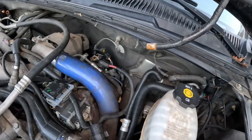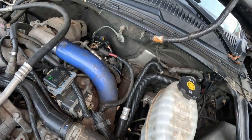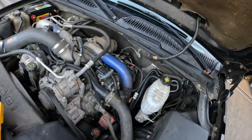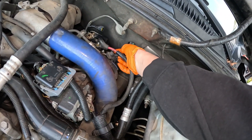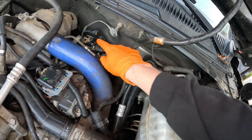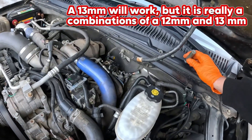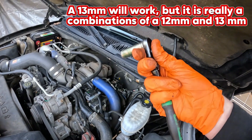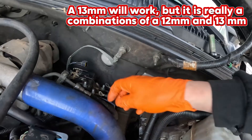I'm going to go ahead and remove this whole controller. Being that we have a live hot wire feeding it, I went ahead and disconnected the grounds on both batteries. Now I can start taking apart these three leads. There are two bolts holding it and we're going to get this out so we can troubleshoot. I used a 13 millimeter and a quarter inch ratchet with a flex head — everything came off really easy.